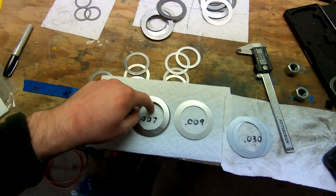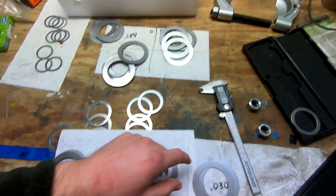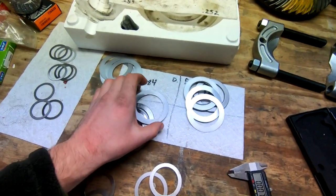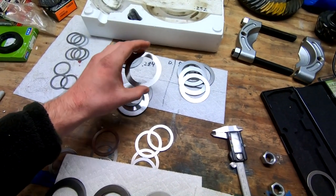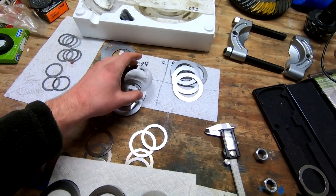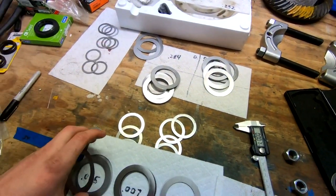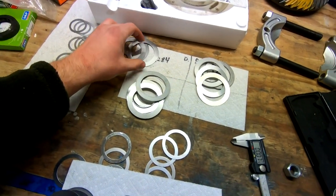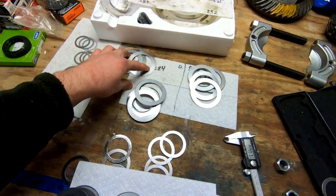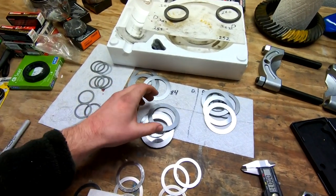This one is a 0.007, which is the one we're going to change. 0.009, 0.030. So all we're going to do really is take away this 0.005, put it here, and add in 0.007. So 5, 6, 7, that's 2. That'll give us those 0.002ths for backlash. There is a chart in the manual down in the description that shows all that, and that's what I'm using to figure it out.